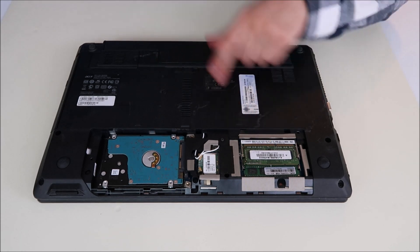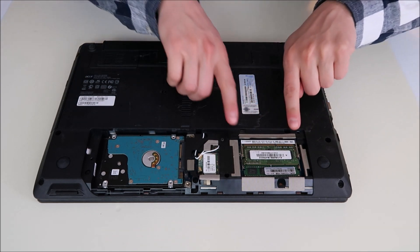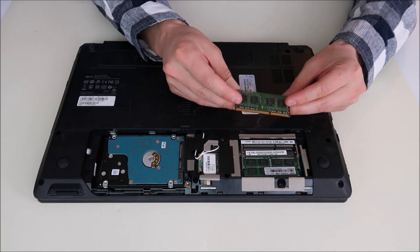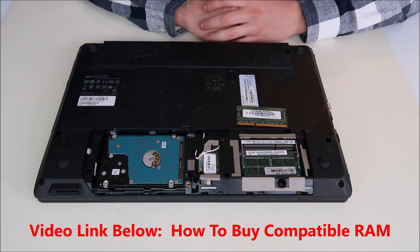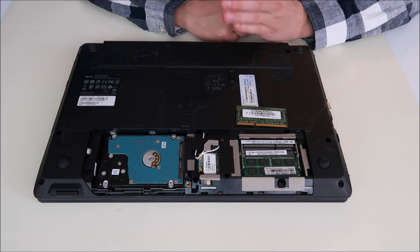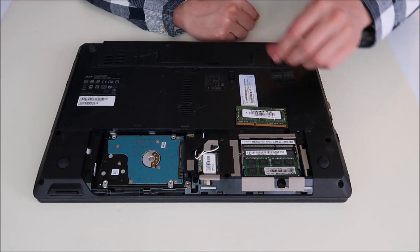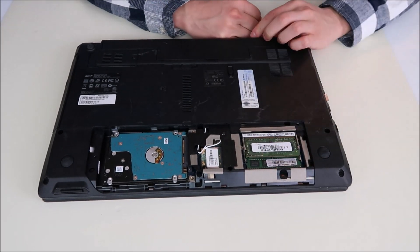So there's your hard drive and there's your RAM. I'll start with the RAM first. It's usually stored with two little spring-loaded arms on either side. You pull those arms apart and the RAM should release, then you can just slide it out. If you want to know how to purchase the correct RAM, check out the video link below in the description. If you're looking for RAM upgrades, I always like going to crucial.com — it's a great website to find upgrades. To put it back in, just slide it back in and press down, and that locks back into place.